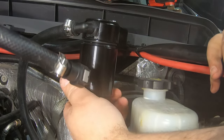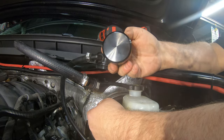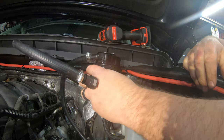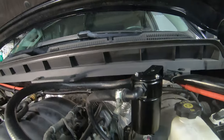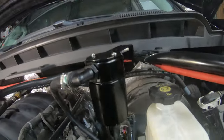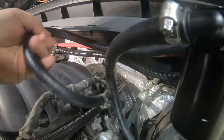When you first put it on, check it every 200 to 400 miles. This one is one of the less expensive ones — it does not have a drain on the bottom, so you have to pull it off each time you want to empty it, then put it back on once you clean it out. Make sure when you hook this up you know which side is the OUT. This hose here comes from the back side of the canister — route it down here and it should clip right on.